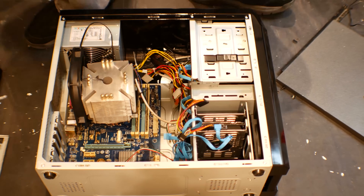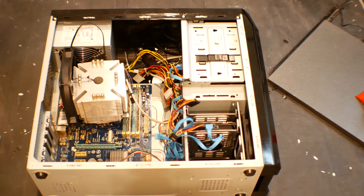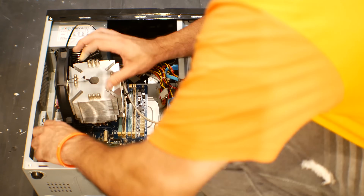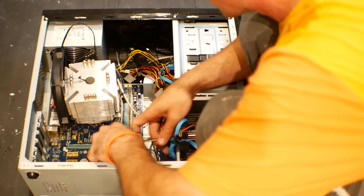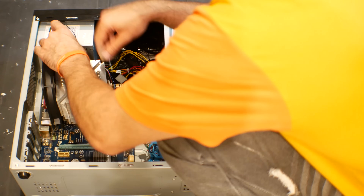Also, if you smell something bad coming out of your system — even if it's a decent power supply, even the best of the best — seriously, turn your system off straight away, find out where the smell is coming from, and stop using that part. Something may be shorting out. In the past I've had one of these cheap power supplies completely fry on me, and while I was in this room smelling the bad fumes for about half an hour, I then proceeded to vomit. It's a really bad experience, one I've been through first hand.